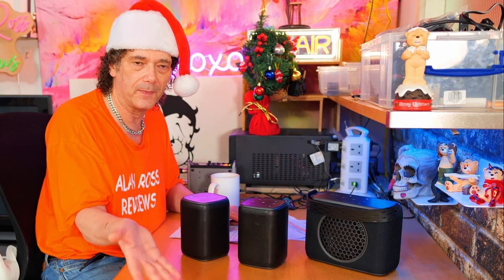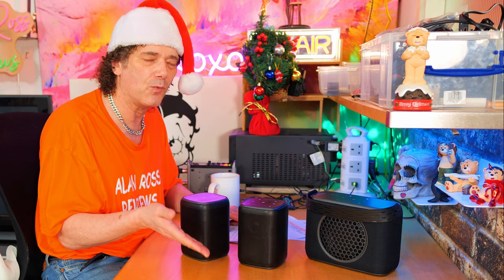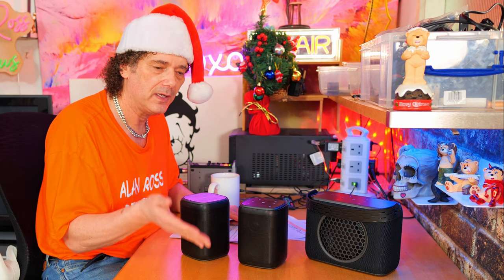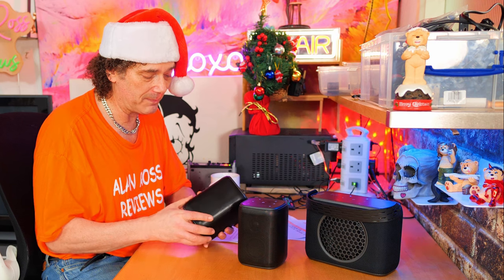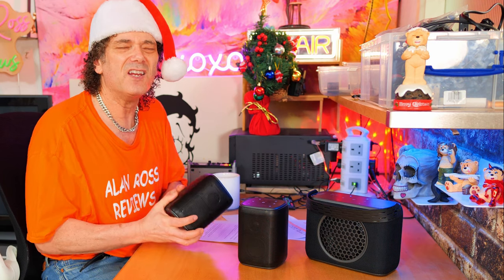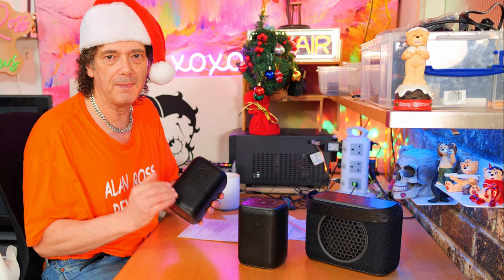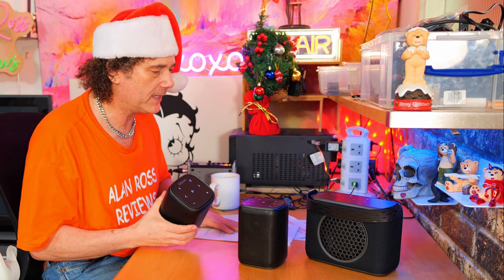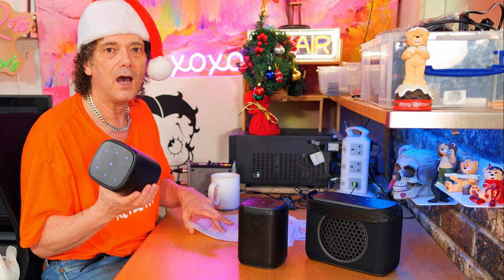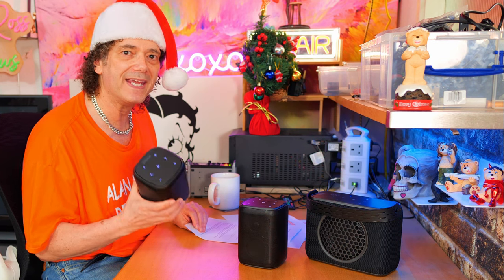Were obviously early frequency response measurements from the company. Are they still relevant? I don't know, but there are big, way outside margin of error differences in how they're measuring the bass. I mean, they may simply be measuring those passive radiators. Measuring bass is awkward, and it should be measured separately to the 500 hertz and up. I don't know how they measured it, and I measure it in a way that I think is still relevant to what you will hear.